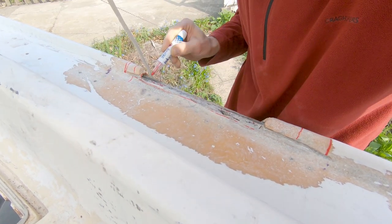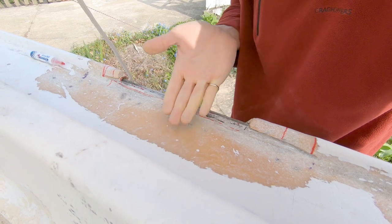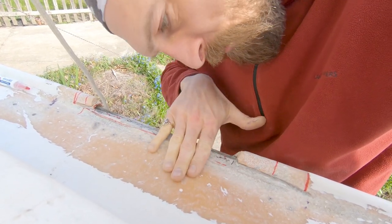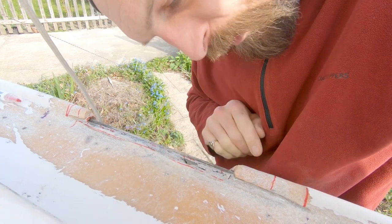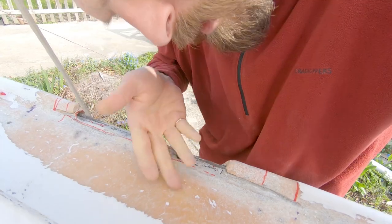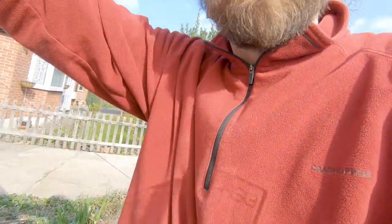Flat that, and this will be a hole. So then we'll post some glass fibre out from underneath and stick it on underneath and post it through, and then bring it over to make a continuous piece, and then apply a new piece of foam and then come over the top with it. So this is much more advanced than any of the stuff that I've done before, but that's good. Yeah, it's good experience, I suppose.